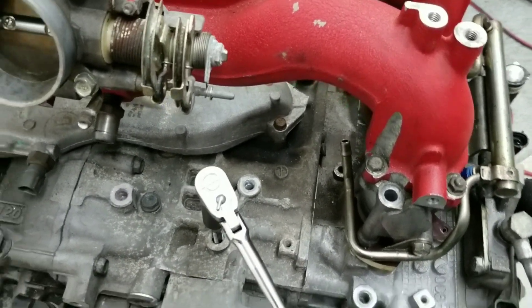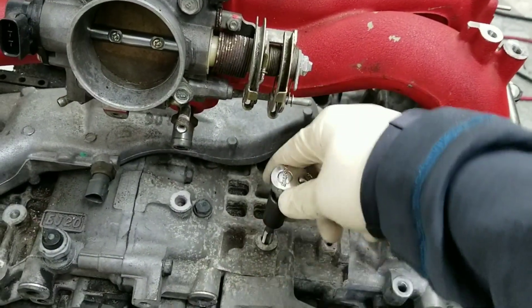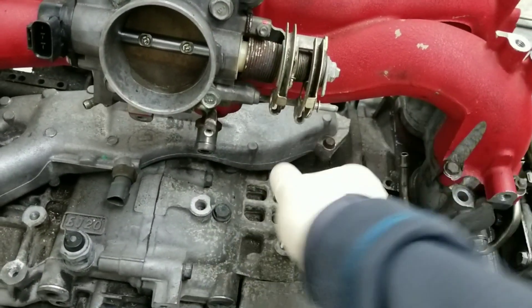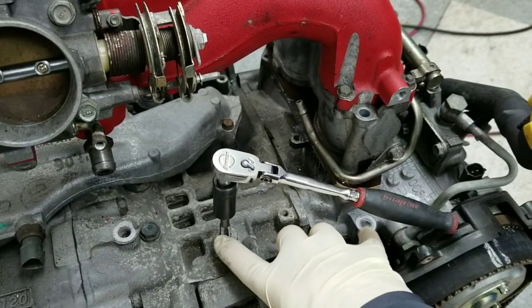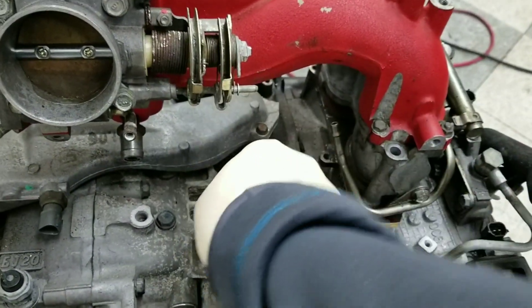I may just see if I can tap it enough. It's not super load bearing - it does have to hold an alternator and tension, but that's the only accessory so it's not crazy critical. I might not helicoil it, just count on the fact that putting new threads in will give a little bit of strength, and these two good holes are going to hold the brunt of the load.